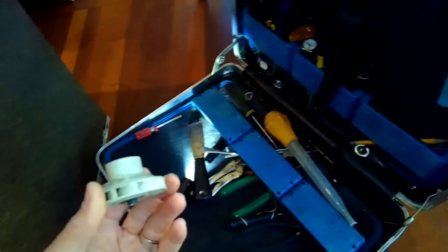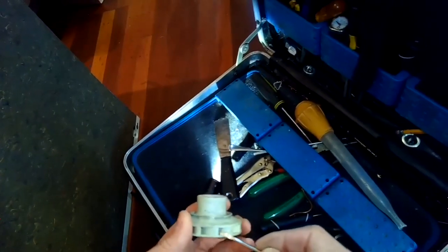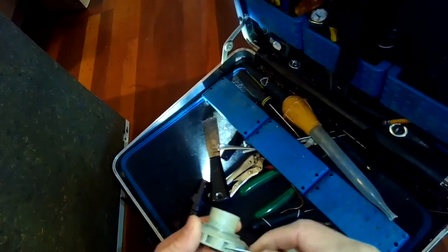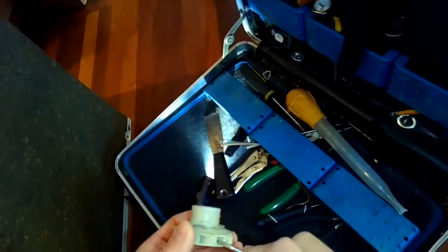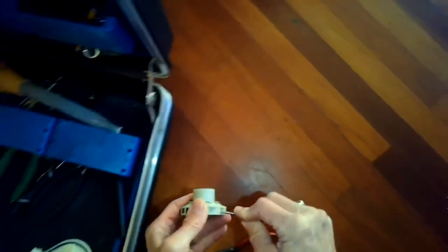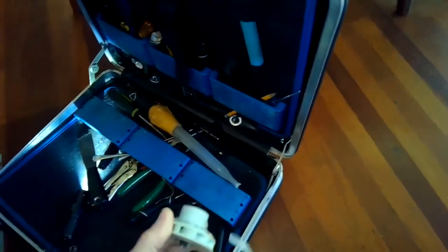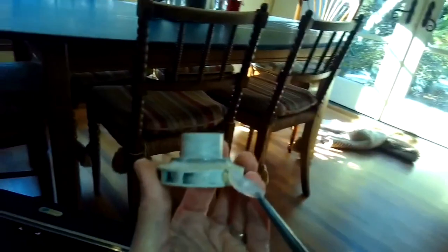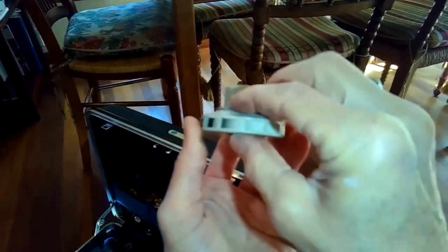The customer accidentally had their filter loose, so some of the junk that was inside the dishwasher got sucked into the impeller. And just one of the little parts of the impeller was clogged, probably reducing its efficiency by 10%. That can be enough, though, to cause an F14 error. So it's a little piece of plastic. I don't know. Looks like a piece of Tupperware got sucked into the impeller vane. I just pulled that out.